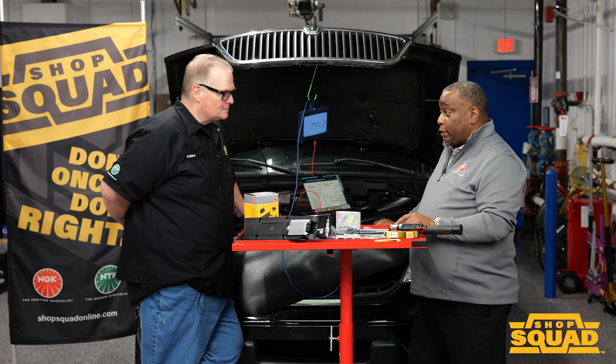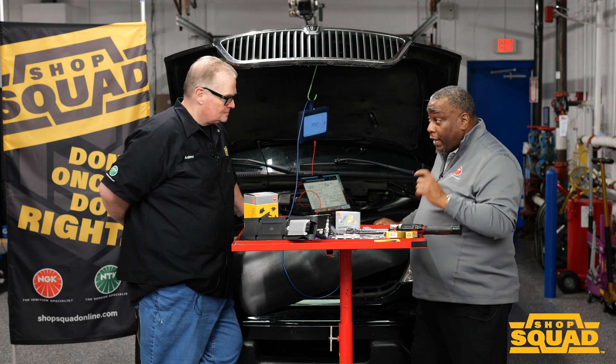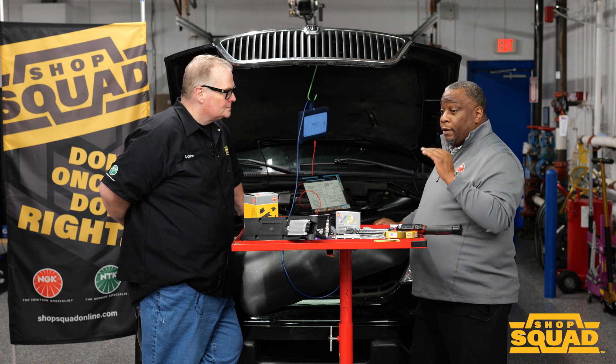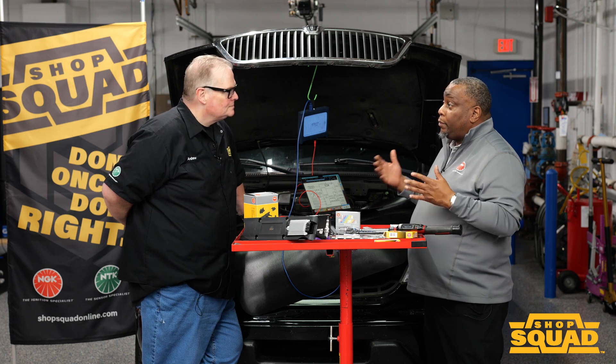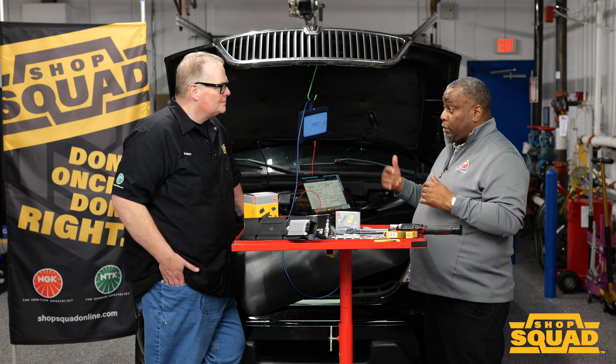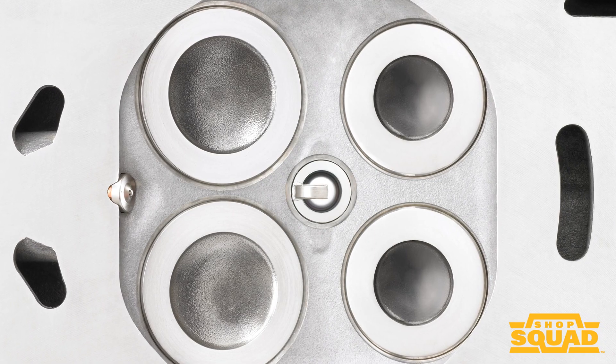Indexing is a term from the racing world — that's a whole different conversation. Now, applying manufacturer-specific replacement procedures with spark plugs, instead of using the term 'indexing,' they're simply saying we want you to torque down the spark plugs to this torque specification. The reason is they want the opening of the spark plug — the ground electrode to the center electrode — to be within a 90-degree angle of the GDI injector and the intake valves.